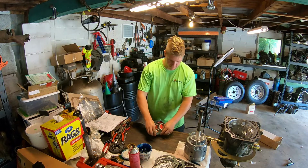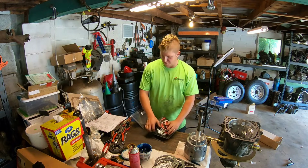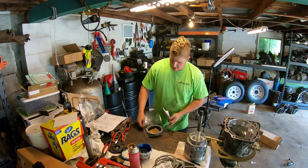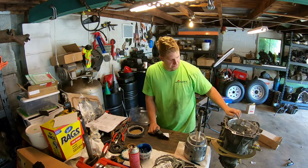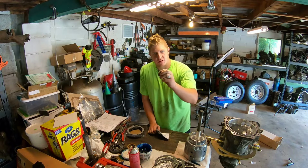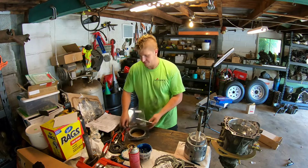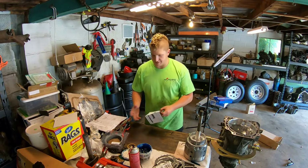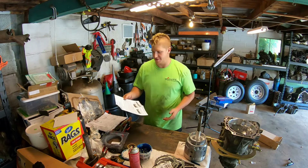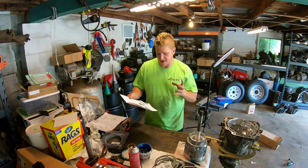My Z-Pack came, so I can finish getting my 3/4 clutch assembled here in the input housing and get this installed. And then I have to take most of this stuff back out because I forgot to put the anti-clunk spring in. So I have to get this put in before I finish putting the power stack back together. The Z-Pack, just like everything else, comes with instructions. I'm just going to follow the instructions, and it should give me a much better 3/4 clutch engagement.